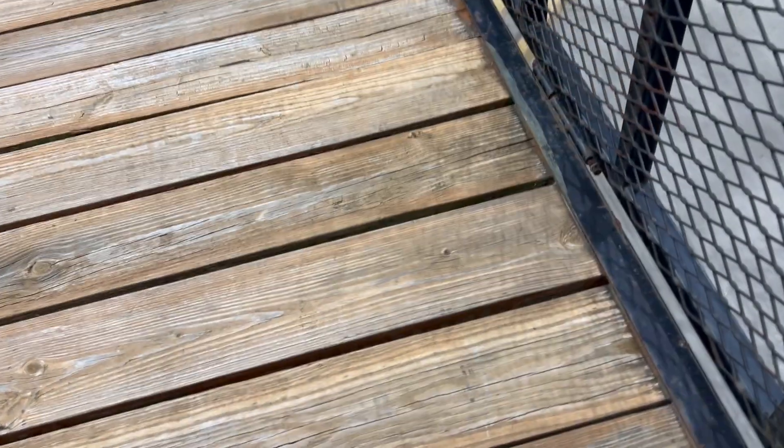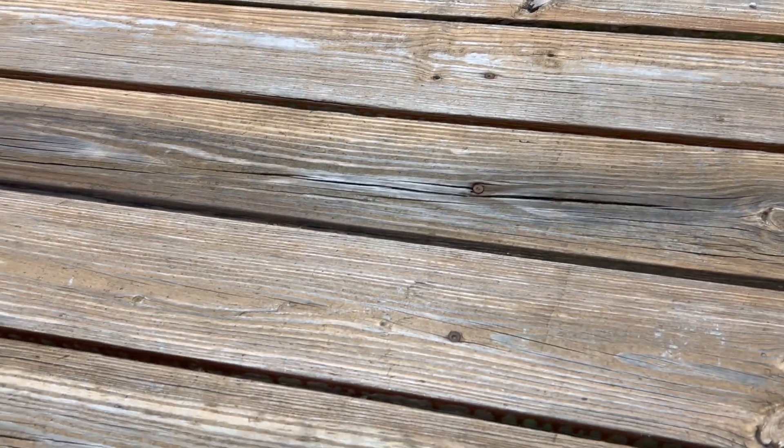Just looking at how these boards are put in — there's a solid steel rail that runs across the back here that kind of holds the end of the board in. And then there's some steel channels underneath the trailer boards themselves. You can see they put a screw all the way across and that goes into that steel channel. I think they're spaced like maybe every four feet or so. You'll see a screw. And then up at the end here we have another steel channel. Actually, this is just a flat stock — a flat piece of steel. And then that's screwed in all the way across.